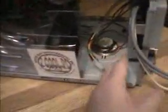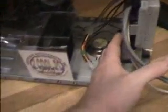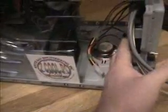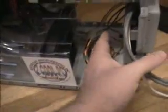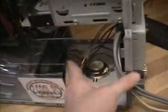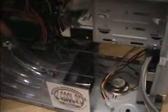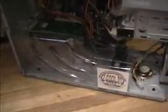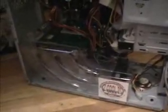So how this works is this. You would take air from the front of your case, whether you have an intake fan or not, it doesn't matter, like I said before. If you have one, however, already installed in your case, it's kind of better because you're taking cool air from the room and you're taking it into the case, and then of course this fan here would then move that air right here as well. So the air is directed from here onto your motherboard and your video card. I have noticed temperature differences between 6 to 8 degrees Celsius. So this is quite a significant temperature drop in case temperature, certainly.